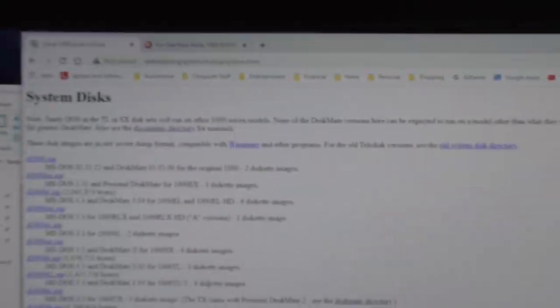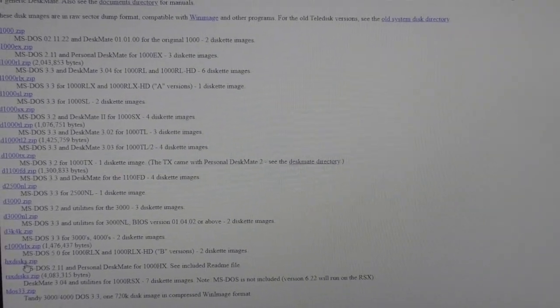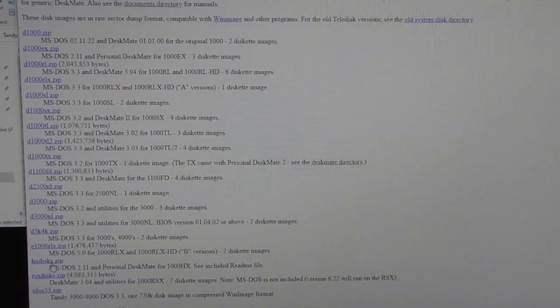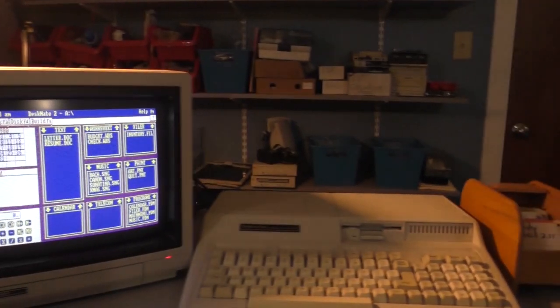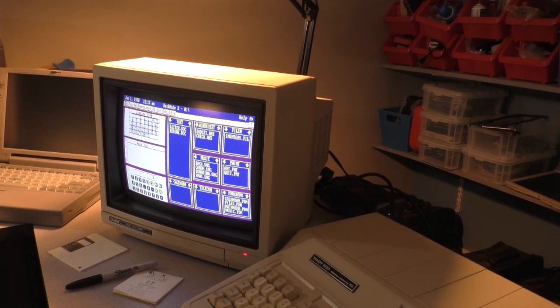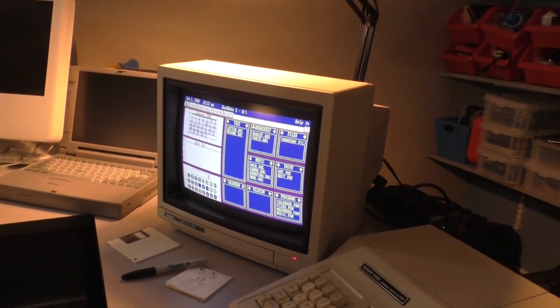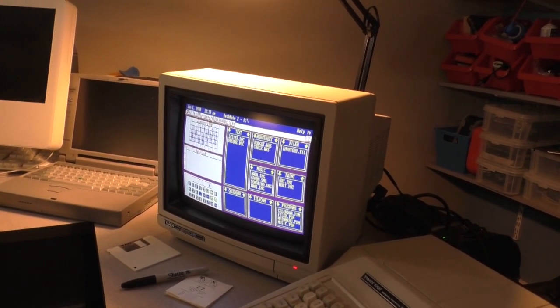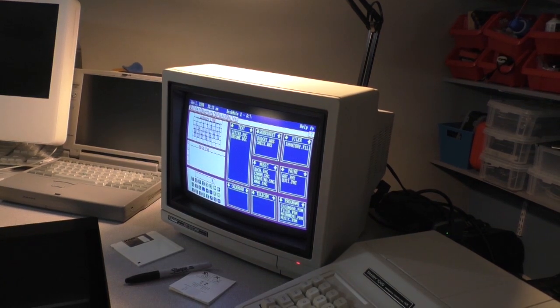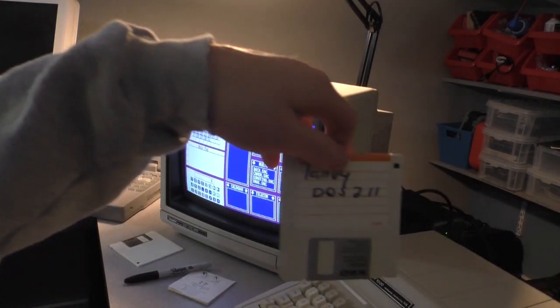I'm going to try to put a link to this in the description of the video so it's easier to find. But this is where you're going to find most of these system disks for certain models. And the hxdisks.zip contains all the files that you'll need to rebuild your system disk sets. Which should only consist of two diskettes, one of them containing Personal Deskmate 2 for the HX specifically, and one of them containing the DOS files that are not bootable. So the DOS disk is not bootable. It is this guy right here.